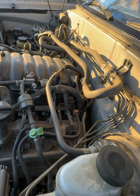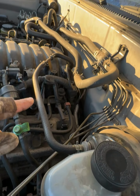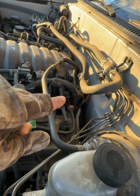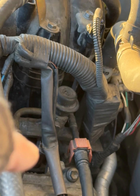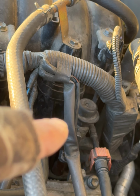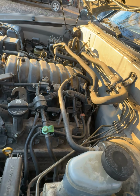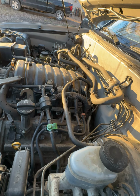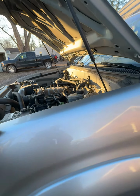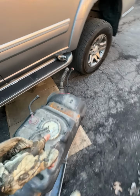But I found a video of a guy testing the fuel pressure. At O'Reilly's, you get the kit and one of the adapter pieces, one of the brass pieces. You take out the dampener, put the piece through the fuel line, and read out the pressure. These should have, I believe, between 35 psi and 45 psi. Mine was only putting out 20 psi. So I'm confident enough to say that it is the fuel pump.